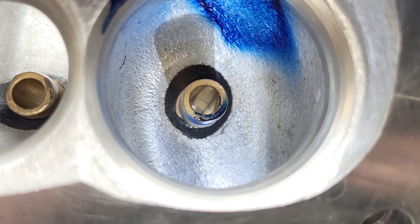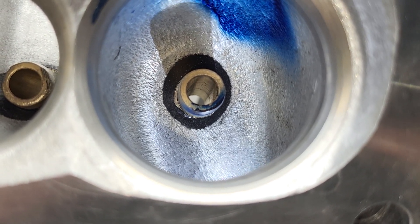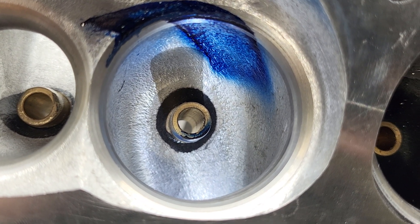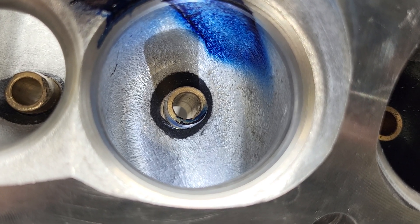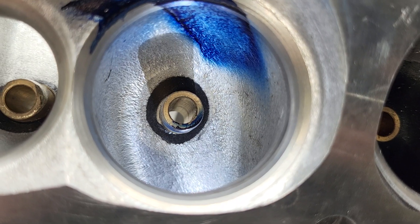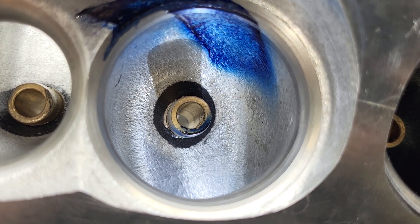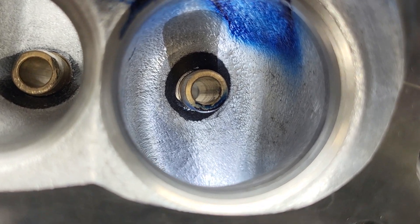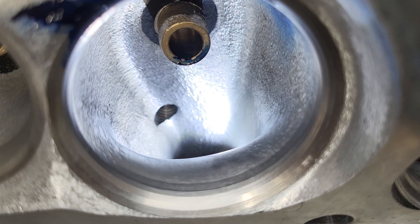The bowl got quite a bit wider, especially on the straight wall — there was plenty of metal there. I could take out a lot more and put quite a big bowl in this, but on a 202 valve that's probably not the way to go. Put a bigger valve in it, yeah. It is not thick everywhere, FYI. It is possible they use the same casting for their 215, so you've got enough metal to go to 215 no problem.